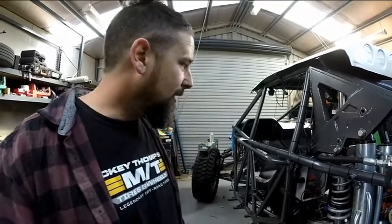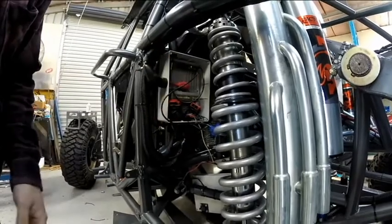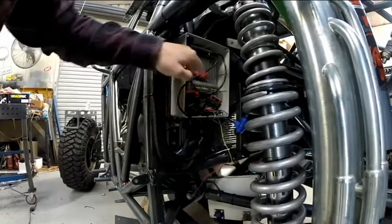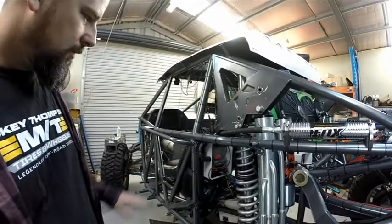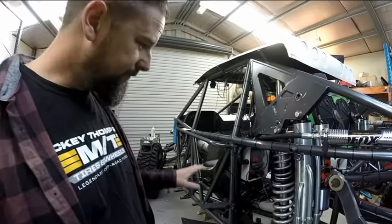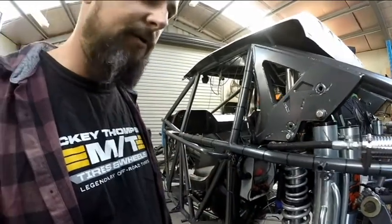So what I've had to do to get past that is, in the last video, this is just a quick recap, I've pulled the header plugs out, and I've temporarily wired the grounds into the header plugs manually through the back there, just so I can power up the smart wire without any risk of starter motors turning over or pumps running dry or whatever. It doesn't matter, because even though the car is wired, because the plugs are unplugged, all the outputs are void. They can be outputting, but there's no power going to anything.